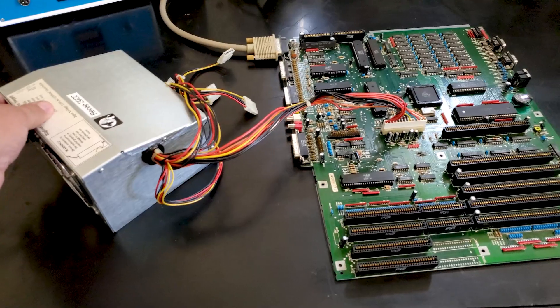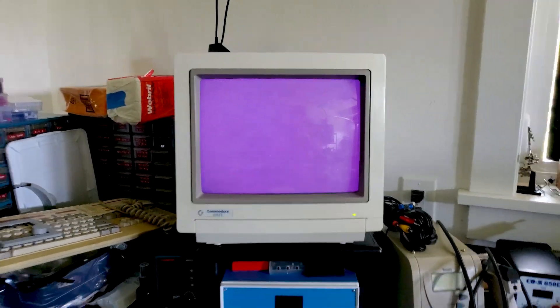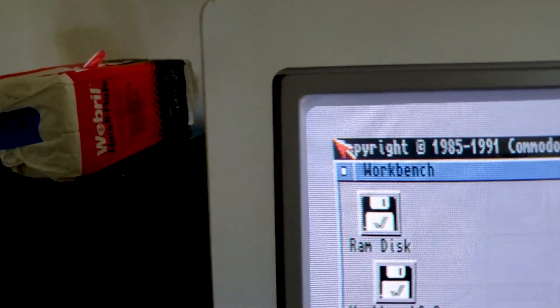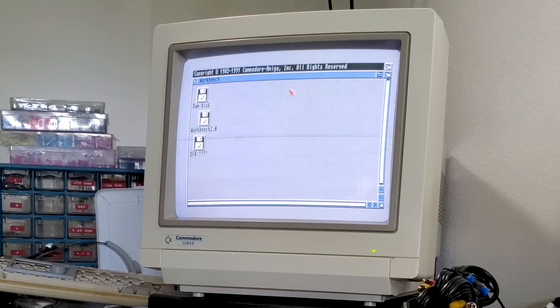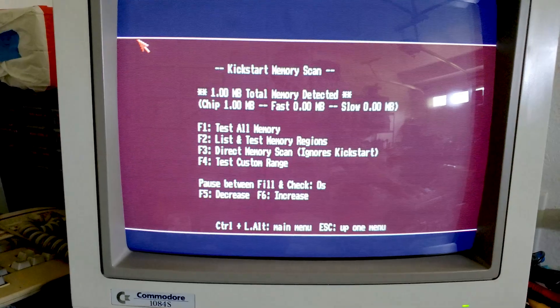Now to test it again! Bazinga! We're getting a kickstart screen! Let's hook up a mouse, keyboard, and disk drive, and see if it boots. We've got a workbench! But the mouse isn't working, and that area of the board has clearly had work done on it before. Trying the other port — and always remember, these are not hot-swappable; replacing damaged chips from plugging in things while the power is on was the number one thing I fixed for people back in the day, so don't do it! The mouse is working fine in the other port, because the mouse only works in one port when in Workbench. I ran a bunch of tests using SysInfo and Amiga Test Kit, and everything looked great! In the next part, this machine will need a floppy rebuild, and hopefully we can get the hard drive working. The mouse, hard card, and accelerator will have to be checked out and installed, not to mention the Video Toaster.